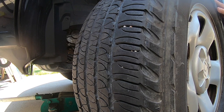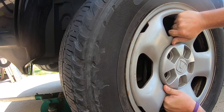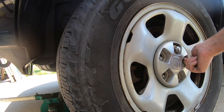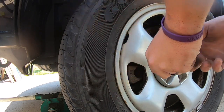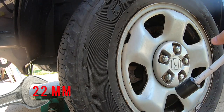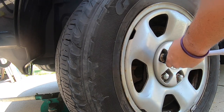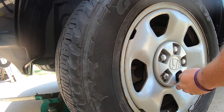Go ahead and grab the tire, put it back up, and place it on the studs properly, making sure it's aligned. Then grab each one of the lug nuts and spin them on four or five times by hand to make sure you don't strip the lug nuts or studs — replacing those studs is no fun. Use an impact gun with a 100 foot-pound torque stick set to 94 foot-pounds. Go in a star pattern — not just around in a circle — and repeat multiple times until the torque stick completely stops. Then you're done if you just wanted to do the one side, but I encourage you to do both and get an alignment afterwards.